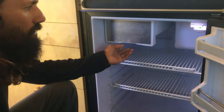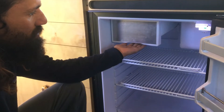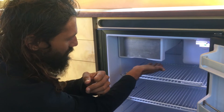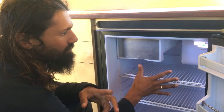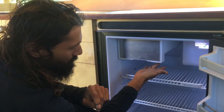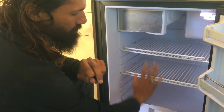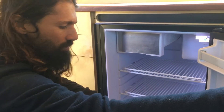In the handbook you'll see how to maintain this. The main thing is if you leave it going for quite a while, a layer of ice will build up and it'll stop the fridge from closing, then the rest of the fridge will get too cold. So when that ice builds up to five mil, you should do a defrost — pull this out and let it all drain down into here.